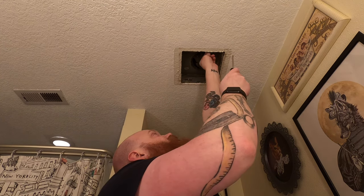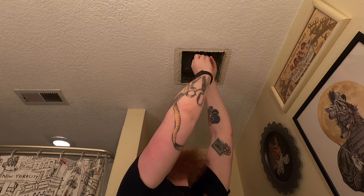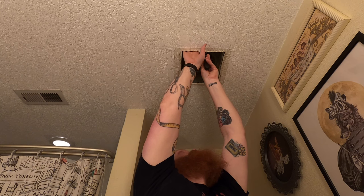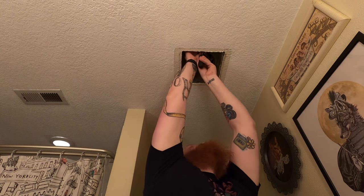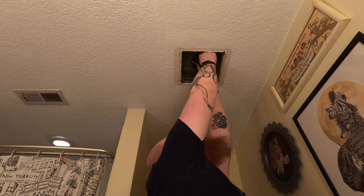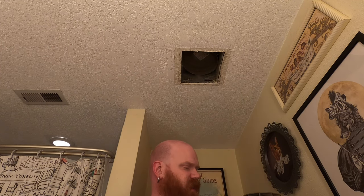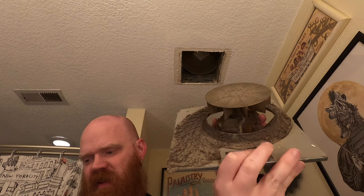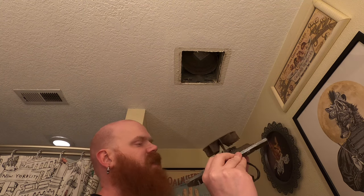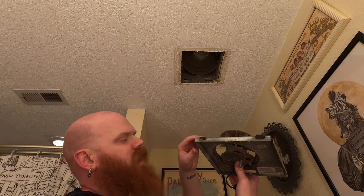I do see one Phillips screw right here. I should unplug that fan — make sure that it doesn't come crashing down on you. It's on kind of a hinge. That is really dirty — no wonder it was so noisy. I don't know how old this fan is; I'm guessing pretty old. So there's one screw here that was holding it in, and then there are two tabs on this side that go into two slots up there, and that's how it stays in place.